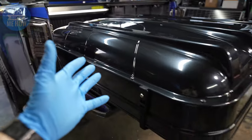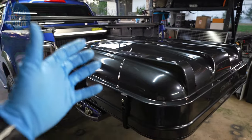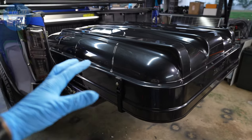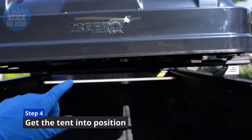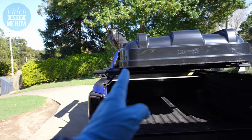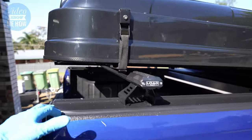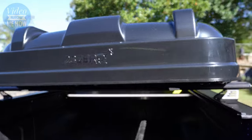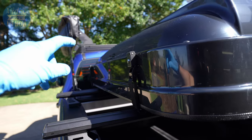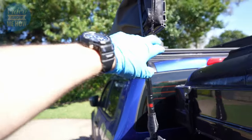In our case this tent is designed for sitting on tubs, so we're good. Next step is to slide it onto the tub into the rough position, then we can get into the tent to pull out the bracketry for final mounting. We've got the tent sitting roughly in position on top. Position your tent where you want it — make sure you've got enough gap at the glass end, and consider the sides if you're running awnings, because the tent opens up and out, so you don't want it scraping.